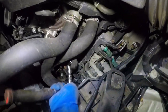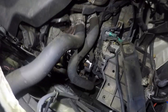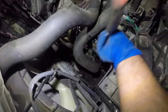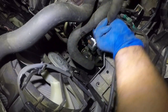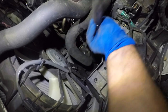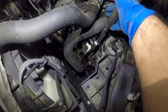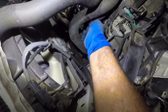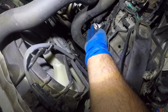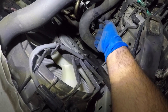We're going to use this 12 millimeter here. The next step is to tighten this really good — don't go crazy because you don't want to crack the starter, just enough. One, two, three — that feels really tight right there. Looks good, feels good. We're going to cover it up so nobody short-circuits that, and the connector goes in and should click. There you go, perfect.